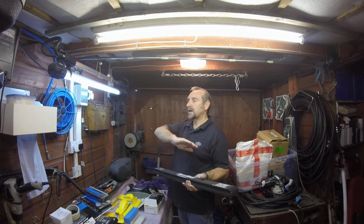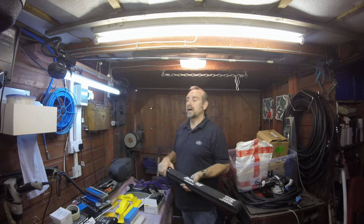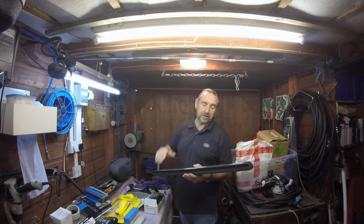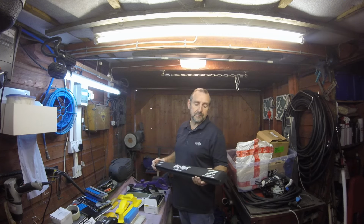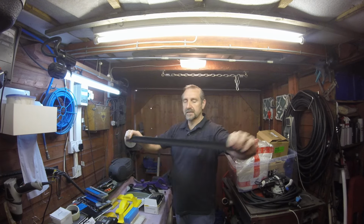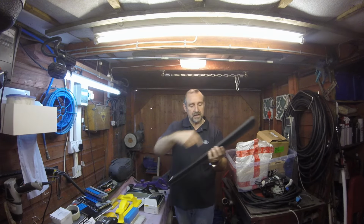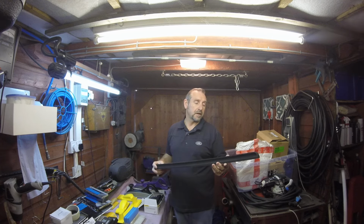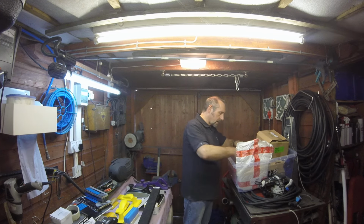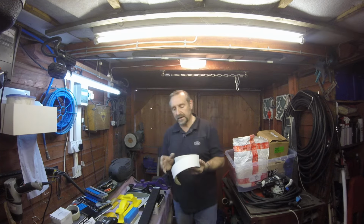If you're flatting down a fillered area, say a roof has had some damage, whether it be hailstorm damage or whether for whatever reason it had a vinyl roof in the past and it now needs to be sanded flat and you've had to skim it with stopper or filler, the biggest block you can find with a slight curve would help you sand down a roof, and that is hard work, but a big block does a big amount of sanding in one step. With these, as I said last video, I'm a big fan of P120.